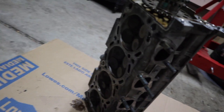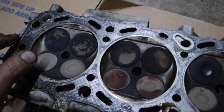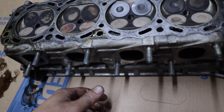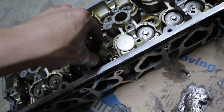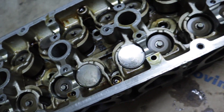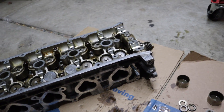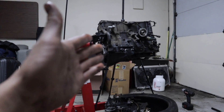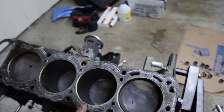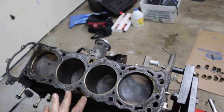I need to bring it into the machine shop and ask them if this still needs work. I definitely want to rework it. As soon as I flipped the head over, all these caps came off — I don't really know what they are but I guess they just cover your valve springs. There's really nothing left we can do here. All we gotta do is take it to the machine shop, have them clean it up and fix any damages — hopefully there are no cracks. I'm having the cylinders rebored a little bit bigger so we can do low compression. Christian told me having low compression is boost-friendly, so I'm going that route.